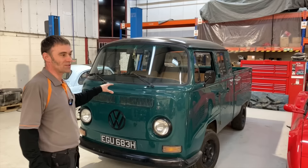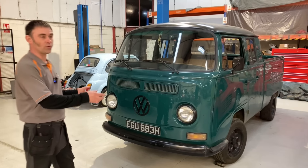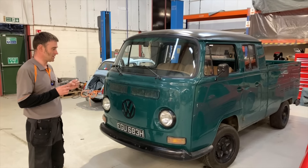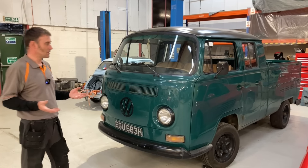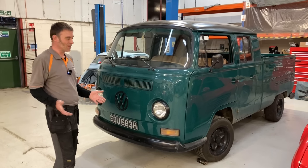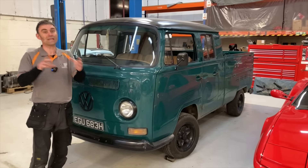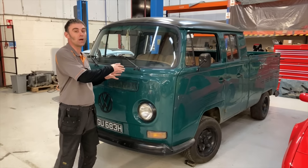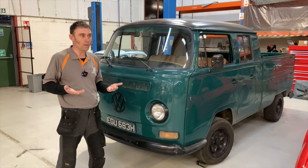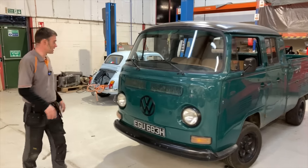And here's my bus — my daily-driven bus. I did this conversion and restoration about six or seven years ago on a budget. I just feel it needs a bit of TLC, though nothing ever really goes wrong with it. The technology I used six or seven years ago isn't the same as what I use now, so we're upgrading the technology at the same time. The chargers in it were 2.5 kilowatt units, two of them making five kilowatts. Now the minimum is seven kilowatts, and we've got 21 kilowatt AC or CCS charging up to 150 kilowatts available, so we're upgrading all that.